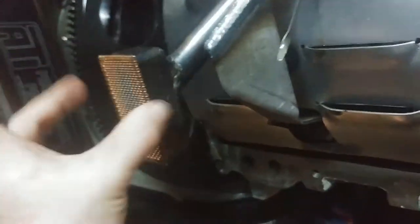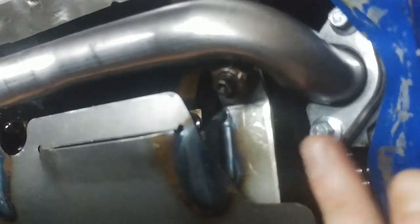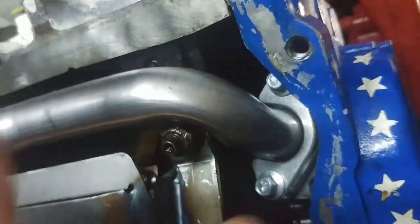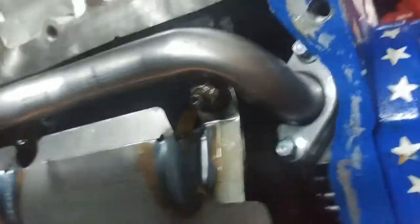The pickup tube is a larger diameter and the pickup itself has more surface area. Another thing I did was put in the oil pickup tube brace, which uses both bolt holes on the oil pump compared to just one on the stock setup. So two holes, two bolts instead of one — it just helps hold the tube in tighter and make sure you don't have any leaks.